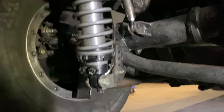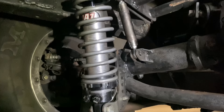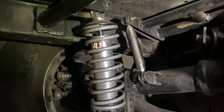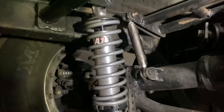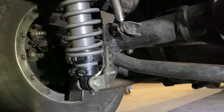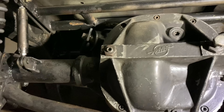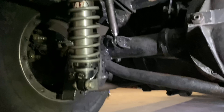What I'm going to do — let me show you under here. So I can keep running the coilover up, but the problem with that is this car separates in the back — it doesn't squat, it's got anti-squat. So you can see there's very little of the shaft that is in the body because the car separates and pushes forward. So what I'm going to do is just move it up a hole on the brackets itself. And this side over here, I've got this side already run up a little bit higher. We'll get the anti-roll bar loose, we'll scale it out, see what it looks like on the four corner weights, and then we'll go from there.